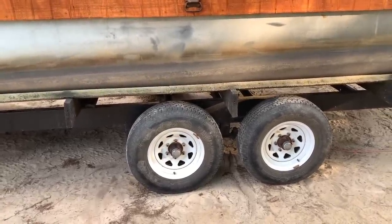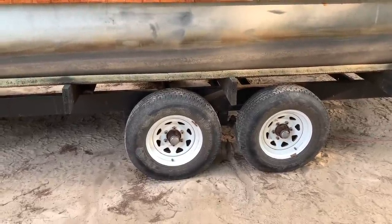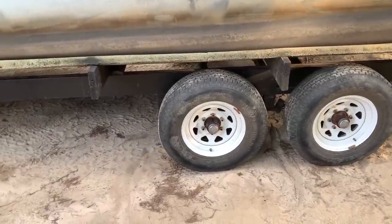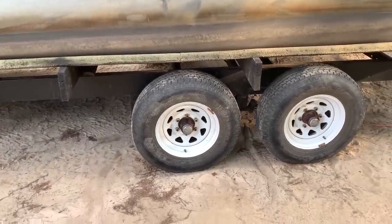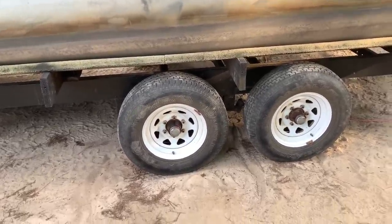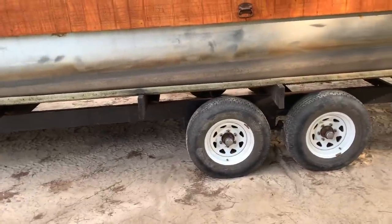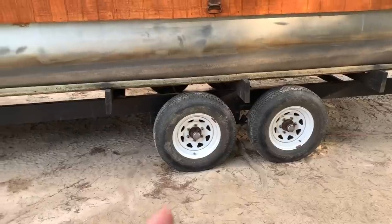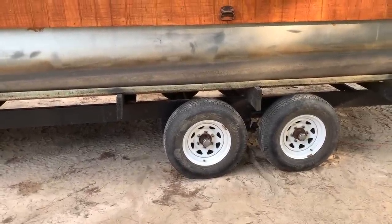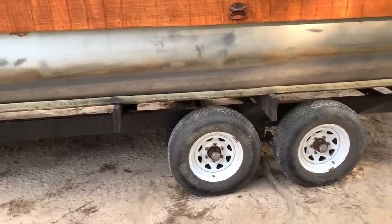Well, this travel trailer frame, both of them had brakes on, and I was hoping that maybe those shoes inside those drums had separated or something and got in there and got it hot. I was hoping that was the case because the other two on the other side were good, and I could hear something on this side. Well, the front one, that one right there, that was the case. One of those shoes had separated and bound up in that drum and it got hot.